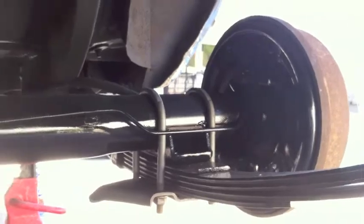What's gonna happen is they'll spread out a little going over the top of the axle, but at least they're close — much better than struggling through those holes. Make sure they fit in here first before you put them on. Now we're putting them on. Try to ignore the rusty brake drums — they're on there temporarily. There is the finished leaf spring install. All brackets are done. I'm going to do minor touch-up because I'm a perfectionist, and then we'll do the silver on the front of the differential.